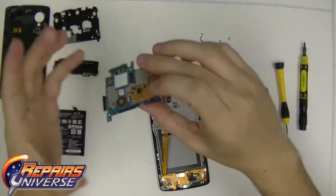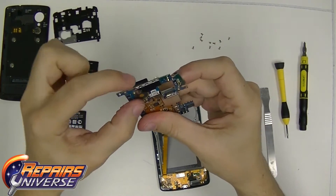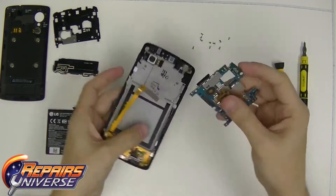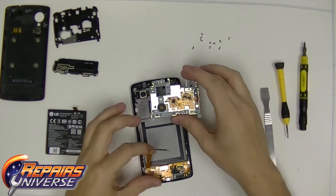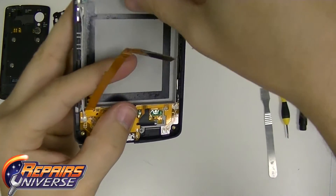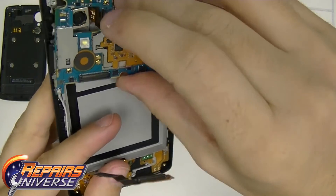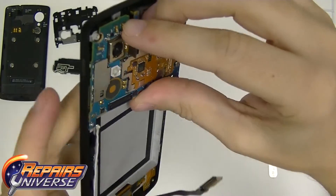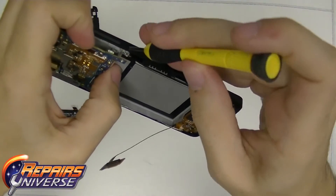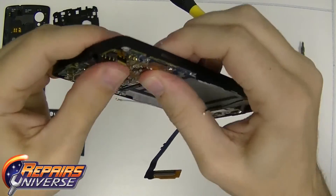Take your time. Do not overestimate yourself. The top motherboard has one particular location you can put it into — do not reverse it. You can notice the correct orientation by the LCD or SIM connector pushing out of the device on the left hand side. Once you're pushing the motherboard inside, if the flex cable of the camera is a little bit off, it needs to fit perfectly into the device. If you see it's wrong, just pull it back just enough that you can slide it in. Once it's slid in, you're going to feel a little snug, but it's going to fit perfectly. Do not smash the cameras, the LCD connectors, or the antenna flex. Pop those out of the way and it will snugly snap into place.